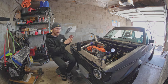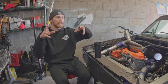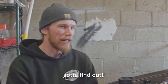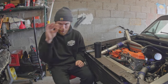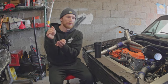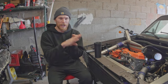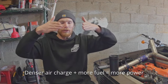On an engine like this we really don't have a whole lot of room to bore or stroke anything. The obvious answer is put a turbocharger on it. Now this video is somewhat turbo diesel specific — you could turbo your naturally aspirated engine but it probably wouldn't go that well. With a turbocharger, it compresses air using your exhaust gases so you're getting a denser air charge, and then to make more power all you have to do is inject more fuel. So that boils down to: turbocharger plus fuel pump tune equals more power.